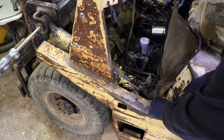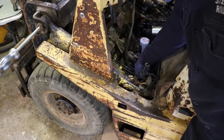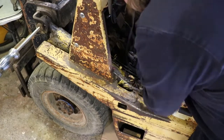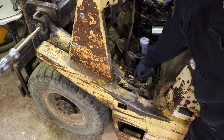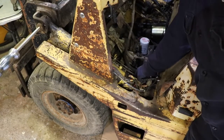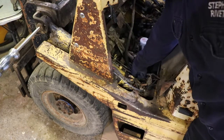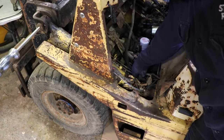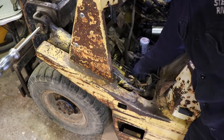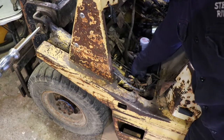Most of the filth on this machine has originated from these tilt cylinders. I wish the previous owner had done something about it other than just filling up the oil. Because it runs down this part of the chassis. Obviously you've got to lift the floorboards to get down into here.